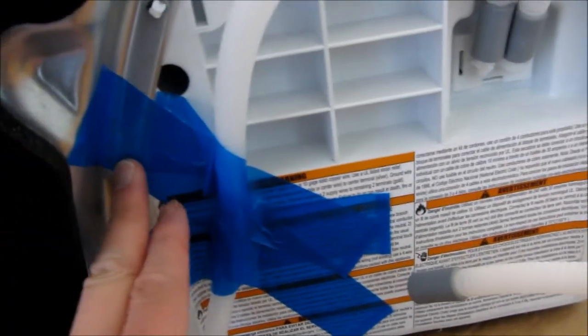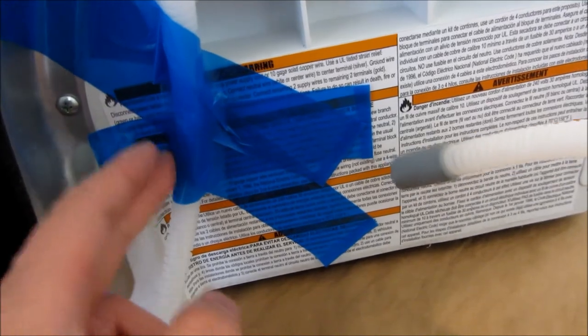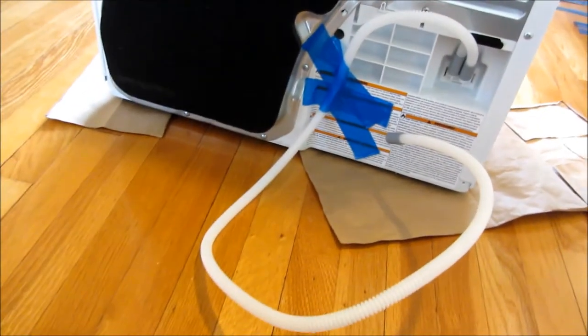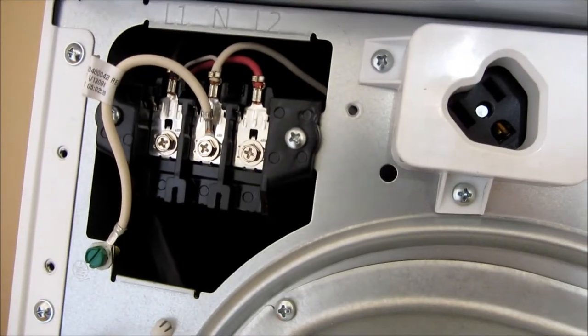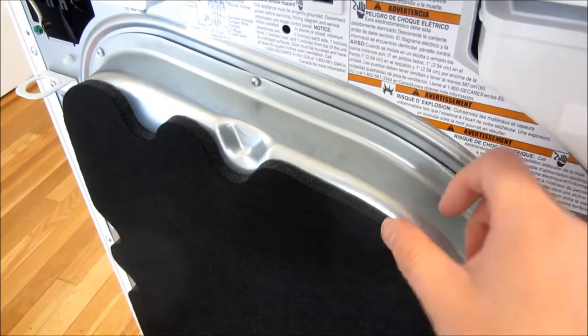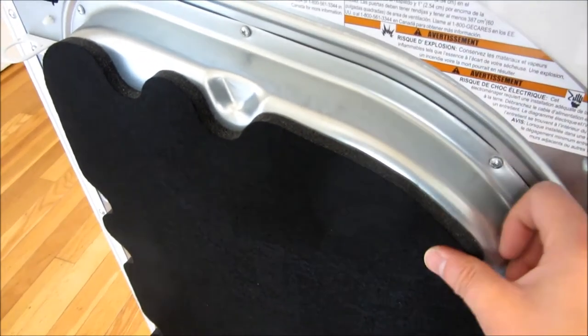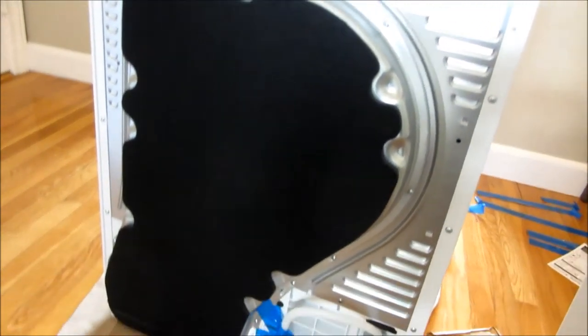I try not to put it against the metal because I don't know whether the metal gets hot, but I kept it a little bit loose and it should be fine. I'm just going to put that in the drain hose, connect up the wiring, and it should be good to go. You can see that is the three-wire and that is the four-wire. This here is, I guess, a diagnostic sort of plug. In the back, you know it's ventless — they have some heat-proof stuff in case you put it right against the wall, so this is cushioning, probably a heat shield also.